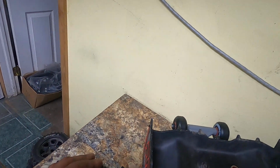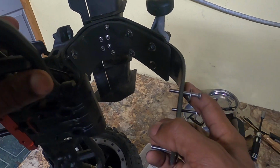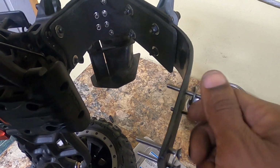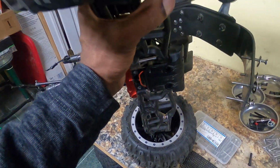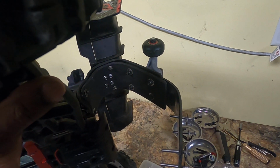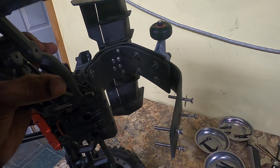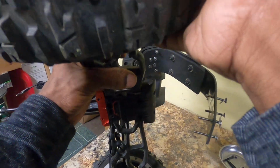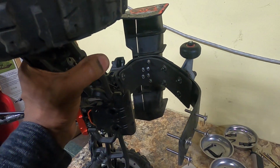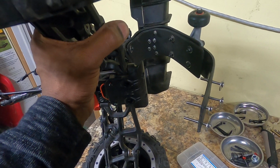And another thing is that the screws I use for the back to mount the wing mount to the diff are huge long suckers that go all the way through the diff case. Usually when your diff case breaks, it's the screws that pop out first. If you drill the hole all the way through, those screws don't have a chance of popping out. So you can land on this from all up the butt if you want to. I was about 15 feet in the air and came down right on the damn thing, and with this and that bash bar, wow, I was loving this setup.